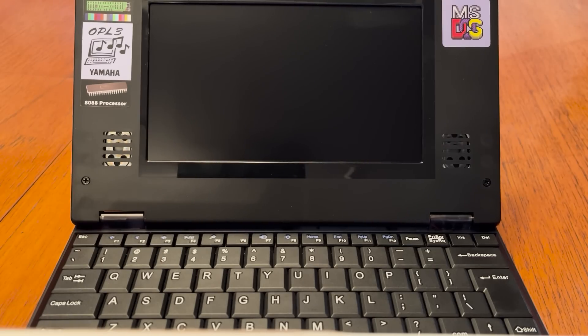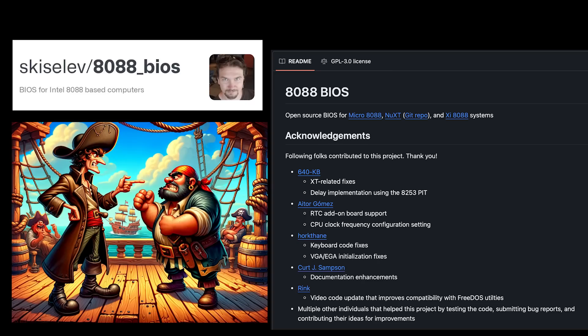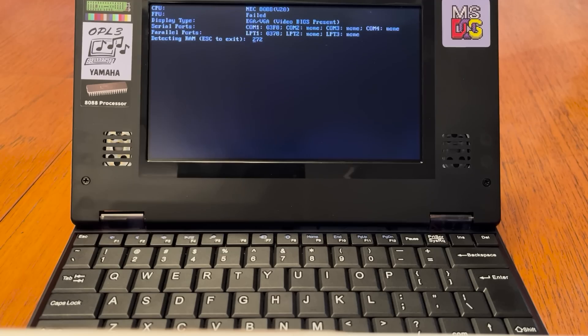First of all we have to give a little nod to Sergei Kisalev whose BIOS forms the basis for the machine, unfortunately in a pirated form, effectively removing credit for his work and also removing code not specific to this device. So I'll be swapping that out myself as soon as I locate my Mini Pro EEPROM programmer. Doing that will not only mean this device can step down from the naughty step, but it will benefit from some core improvements too. The new BIOS has been optimised for the NEC V20 chip and disk transfer speeds will apparently almost double.